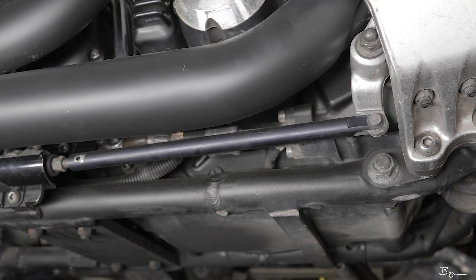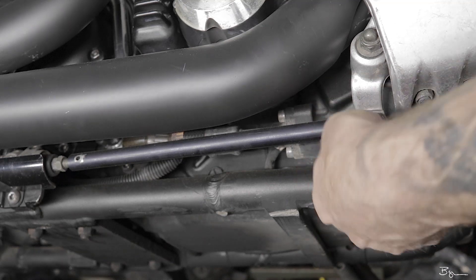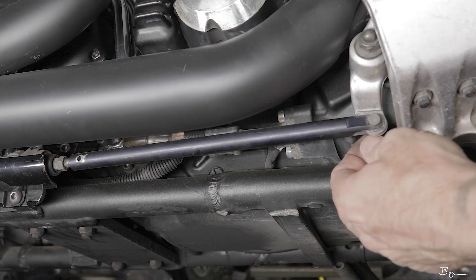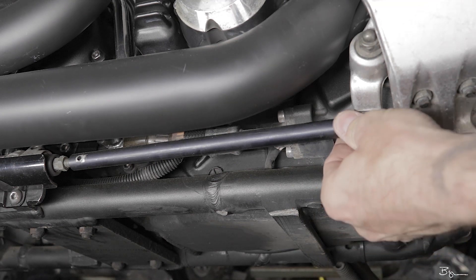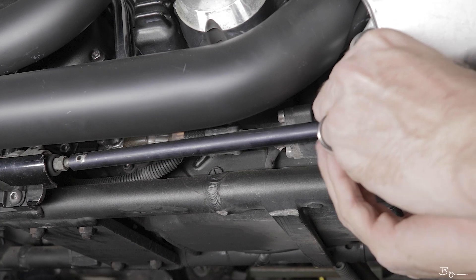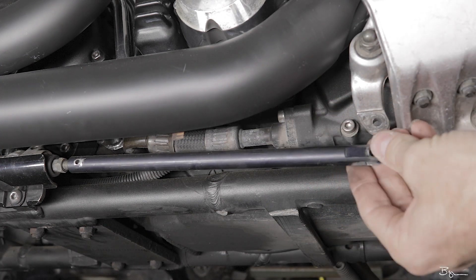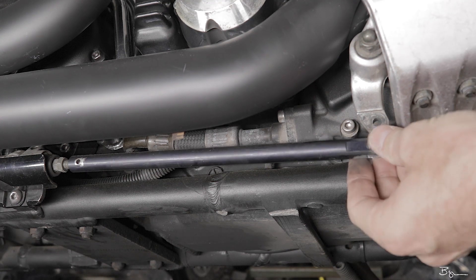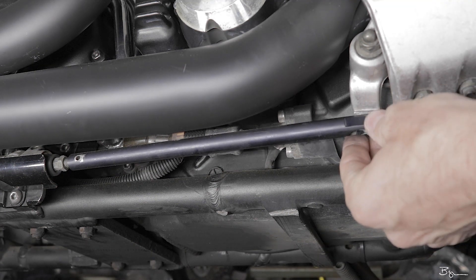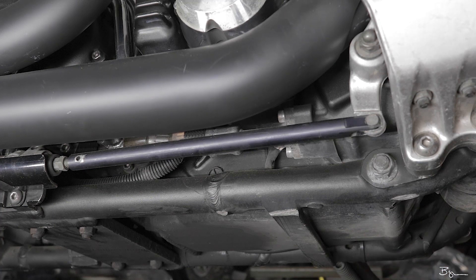Now on our brake side, it's going to be just a little bit different. On the bottom, you've got a joint and a cotter pin on the back side. The first thing we're going to do is unbend that cotter pin and get it pulled out so that we can release this pin here. Once you've got the cotter pin straight and pulled out, you can take that pin and pull it. There is a washer on the back side, so make sure you don't lose that. Then you're just going to take it and twist it — one way is going to pull it in, one way is going to pull it out. Twist that and get it positioned to where you want it. Once you're happy with it and it's not hitting on your exhaust, go ahead and take your pin, stick it back in, replace your washer on the back side, and put that cotter pin back in.